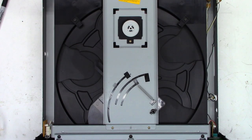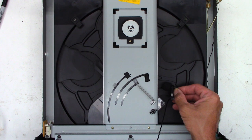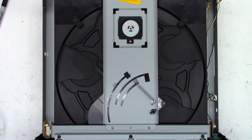This is a Harman Kardon FL 8400 multiple disc changer. Listen to this power on — I hear a motor running. Let's try that again with the microphone detached. Power off, power on. Bad belt possibly — let's take this thing to bits and see what's going on inside.